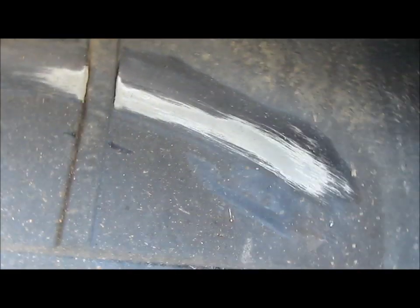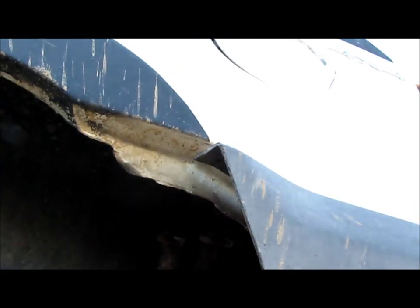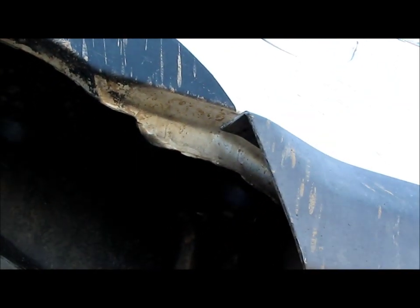And while I'm showing you this, people have been asking me a lot of questions about what trimming did you have to do for 35 by 12.50 tires? And the answer is not a whole lot. In the back, the problem I was having is this bumper. You can tell I've cut that. It used to come out to right here and go down. And so I just masked it off with tape and cut it. I think I used a Dremel tool, I don't remember. Actually, I might have used snips.